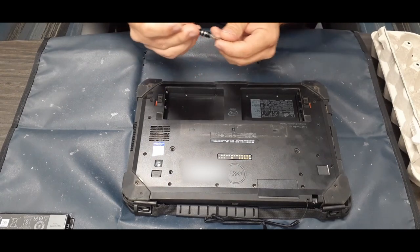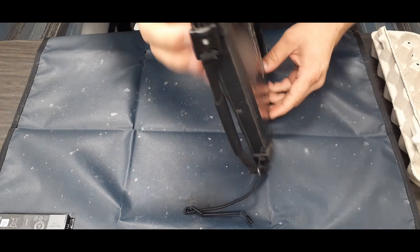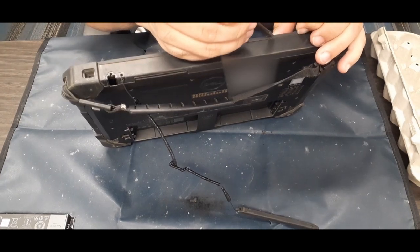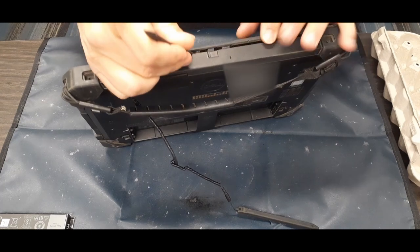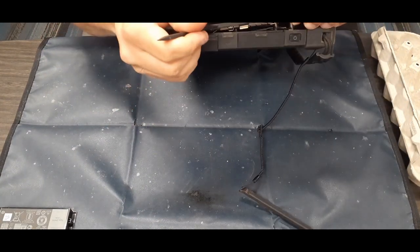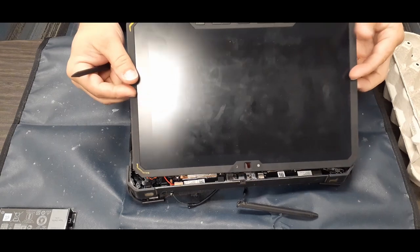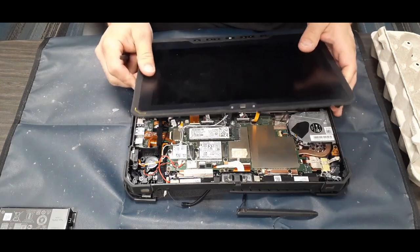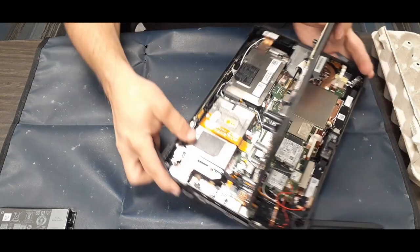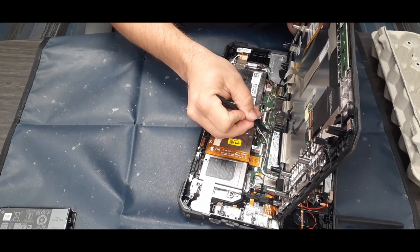Once you're done with that, you're going to separate it — and the back is not the piece that comes off; it's actually the LCD part. You can see the pry tool going in there. There are no actual tabs holding it in, but it is a very snug fit. There are some wires that attach the LCD to the internals — three of them. One is for the buttons at the bottom of the screen, one is for the digitizer that senses your finger input, and the third — the widest one — provides the actual video signal.